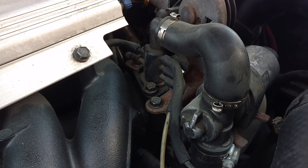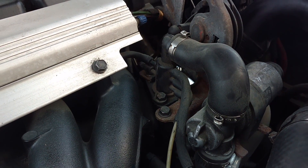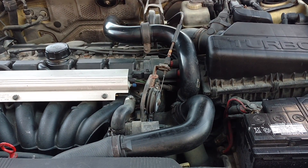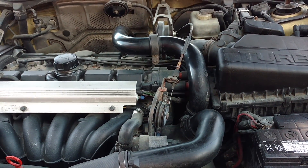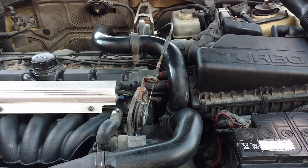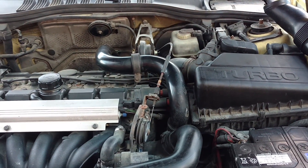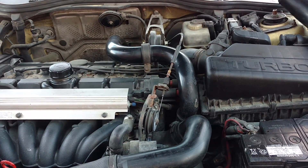These lines go to things like your cruise control, your boost gauge, your vacuum pumps, and your emissions. They all have to be connected and in good shape. Yesterday I was driving along and the car started running a little funny — it didn't want to run smooth. The idle was wandering a little bit up and down. I immediately suspected that I had a boost leak. Then I punched it, and when this car is normally slamming and accelerating aggressively, it basically accelerated like a car that was towing something. It was struggling, so I figured I had a boost pressure leak.